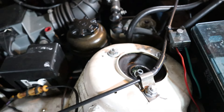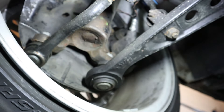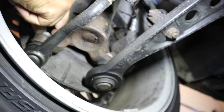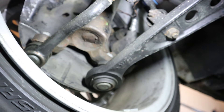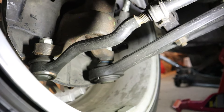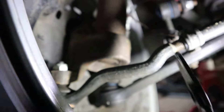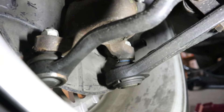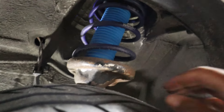Now I'm going to do a visual inspection — looking at these bushings and making sure everything looks good. What you can do is take a flathead screwdriver and wedge it in between these components, check all the bolts, make sure they're nice and tight. Really you're just seeing what's loose or wiggling. Take a flathead and jimmy it between things to see what makes noise. Even this bushing right there is starting to look like it's getting a little past its days. My stabilizer links look good though.